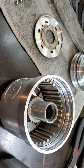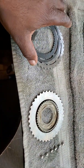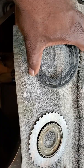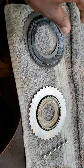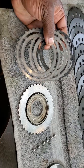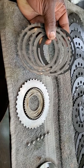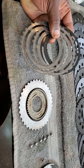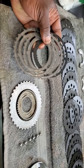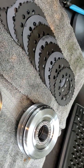You guys have been a great inspiration for the parts we're designing and developing, and we will continue to innovate specifically for you. We are actually working on a new ramp clutch assembly that will use two of the rubberized clutches, so that you have twice the amount of grip with half the electromagnetic energy. What that means is this coupler will no longer be all-wheel drive — it will be on or off. We're also working on a couple more variants of these couplers. The Fusion guys will be testing as well. More coming — stay tuned.